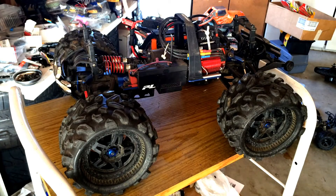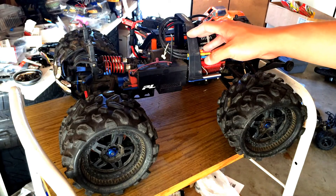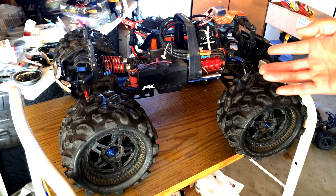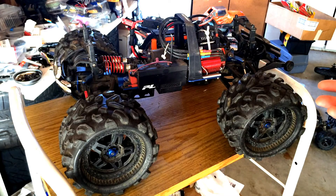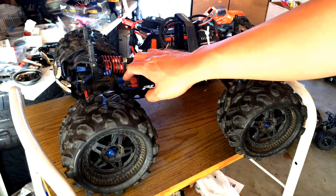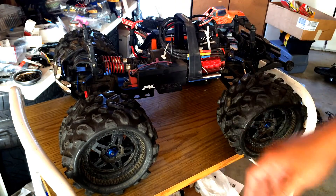A couple of things about it: it's completely waterproof, which is great for these monster trucks being able to go into all conditions. Another great feature is that it has an adjustable battery eliminator circuit, or BEC, and you can adjust that from 6 volts to 7.2 volts. This is really nice because large scale speed controls like the Castle Mamba Monster have been known to have not the best BECs, which leads to erratic performance from the servos and radio gear. The ability to run 6 or 7.2 volts allows this speed control to handle even the beefiest of steering servos, especially needed for these large monster trucks.